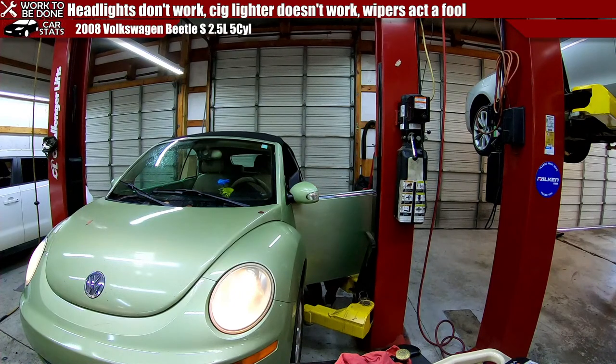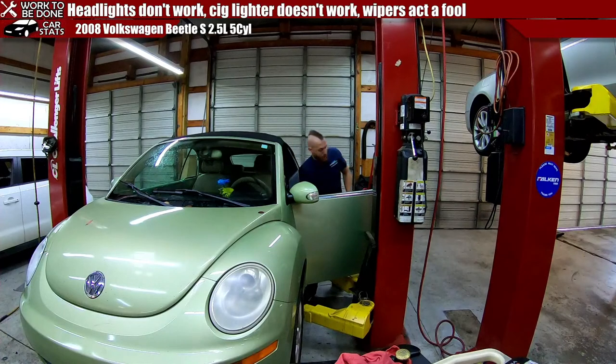Now that it's been a minute, let's turn. Yeah, if I pull down on the wipers, I hear a click. And I just heard it turn off. So again, this is a bit of a guess, I'm just taking an educated guess that I think the relay's working okay. So I think it's worth us getting down to the wiper motor itself and trying to probe the wires there to make sure we're getting signals.